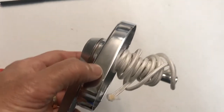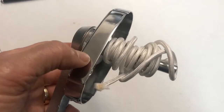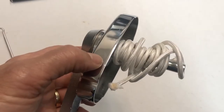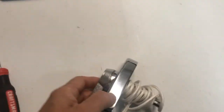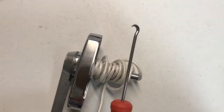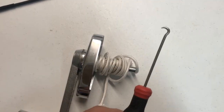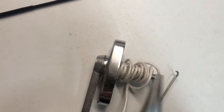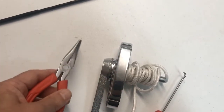What we're going to do is simply remove the light switch and the little light socket, and that will allow us to look inside there, reach in with a tool, and grab the end of this rope. I like to use little hook tools like this. If you don't have one of those, a coat hanger with a little bend on the end works. Maybe even some thin needle-nose pliers will work for you.